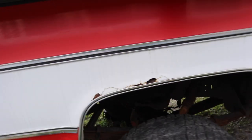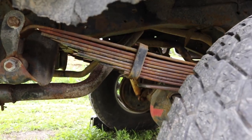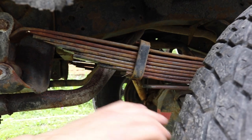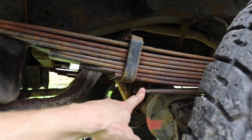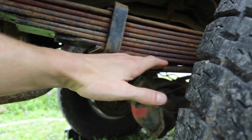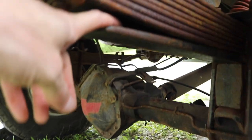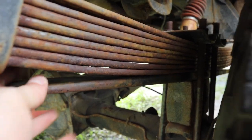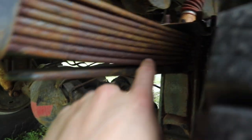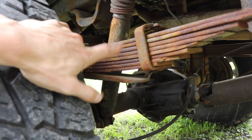The squatting isn't the issue — the issue is it's swaying. I don't have a front or rear sway bar in this truck because I didn't build it to haul a camper, and now we're trying to backtrack. I talked to a guy — Kenny of All Trades, check him out, he's got great truck camper videos exploring up in Minnesota. He recommended I install something similar to the Torque Lift Stable Load modification that goes in between the overload spring. It would wedge in that gap so you're always riding on your overload spring.